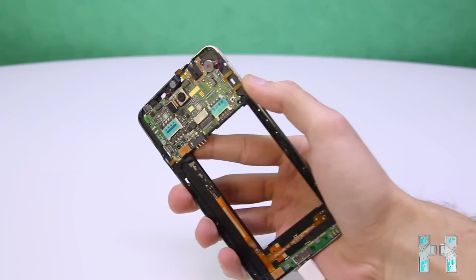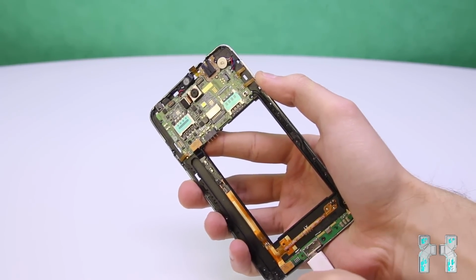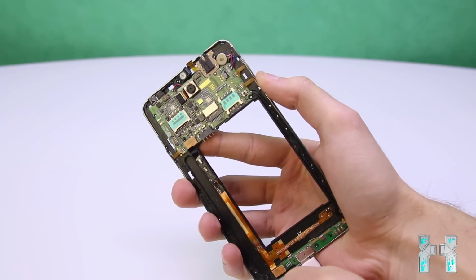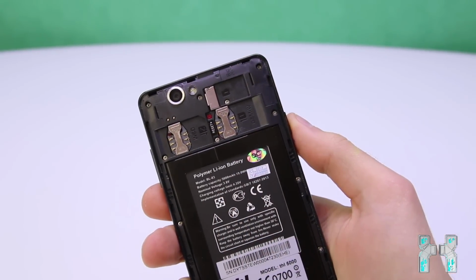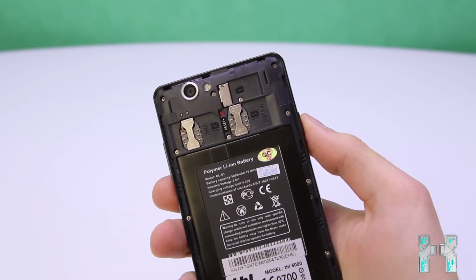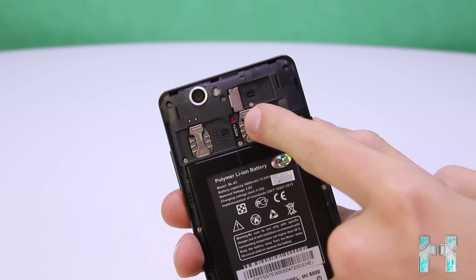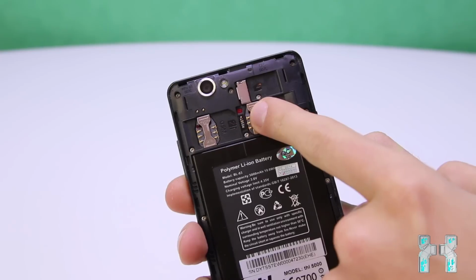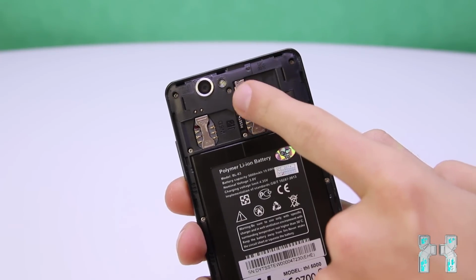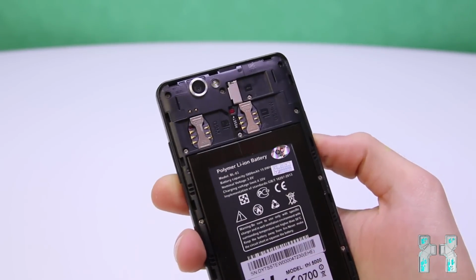But if you cannot get it connected like this, so with holding one of the buttons and also keep pressing it, then we have to do a hardware mod. But if you have a device with integrated battery, just like the THL 5000 or any iPhone clone, you have to be careful, because those devices usually have a reset button. Here on the THL 5000 you can easily see it, but some iPhone clones have the reset button between the volume buttons, and it's very hard to find.